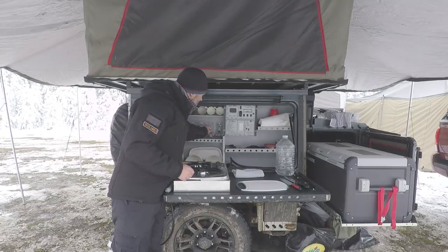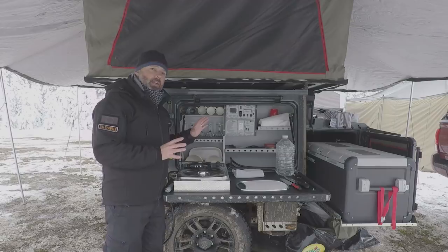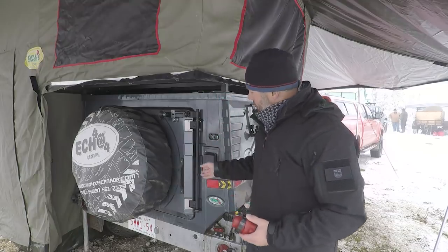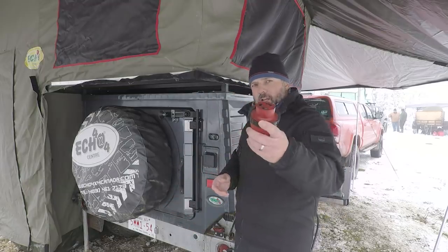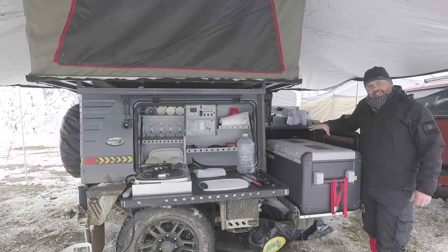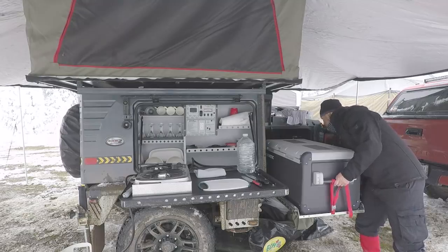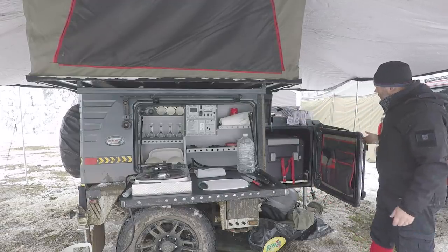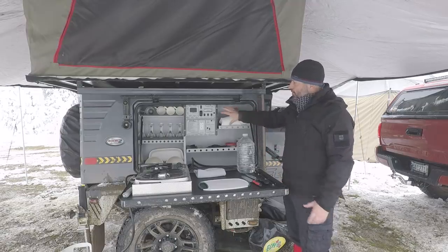That's living in luxury. This is your onboard power management system. There's a 12 volt battery that charges and has everything in here. When you're at home and need to recharge your batteries, it comes with a 30 amp 125 volt adapter that simply threads on — get your extension cord and recharge your battery while parked in your garage or driveway. All of the Echo trailers are equipped with a 75 quart Dometic freezer cooler system on a nice power slide that locks into place. Everything has an automotive seal so there's no moisture or dust getting inside the compartments.